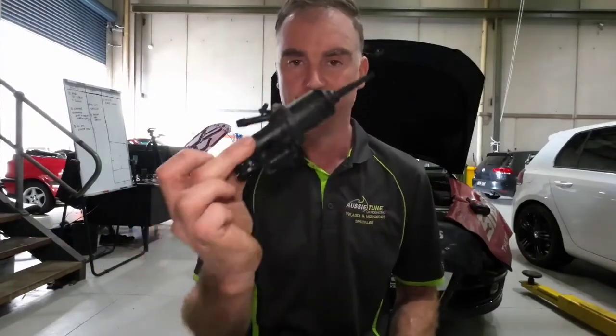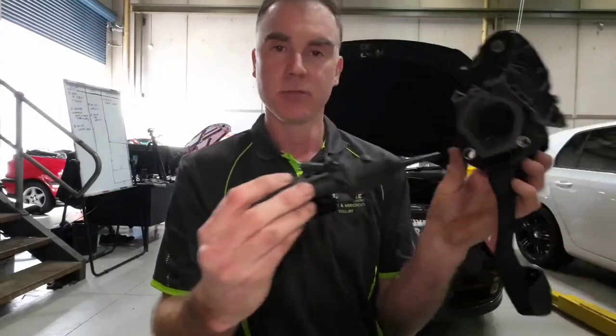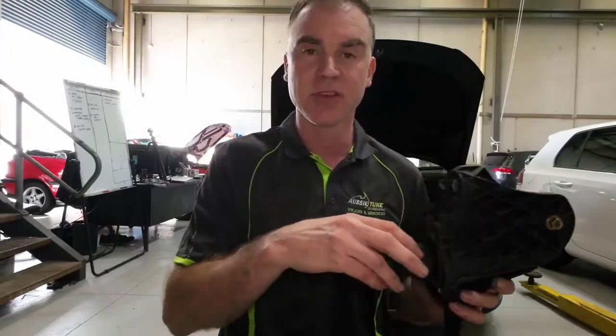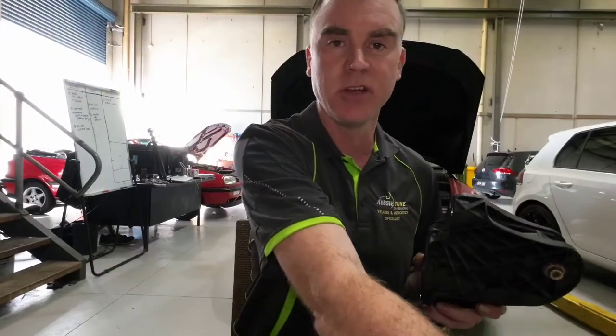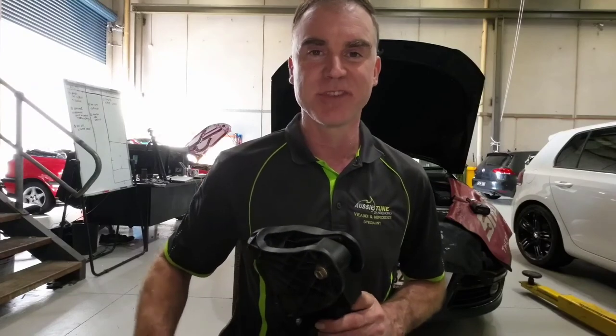The repair here is replacement of the slave cylinder, which presses down into the back and locks in. The whole lot gets fitted back into the vehicle, we bleed the clutch with new brake fluid or hydraulic fluid, covers back on and the repair is fixed. Thanks for watching, see you at the next one.